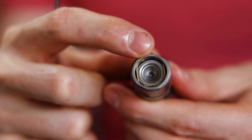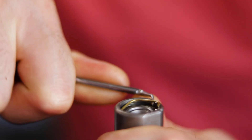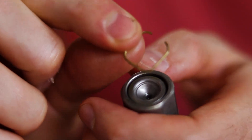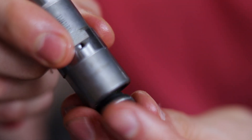It's pretty simple. I'm going to show you how to break this thing down and convert it to a solid lifter. There will still be a little bit of play, but I'll get to that. So when you're looking at the hydraulic roller, there's a little clip in here. First thing we've got to do is remove that clip and just kind of work that thing out. There we go — first clip is out.